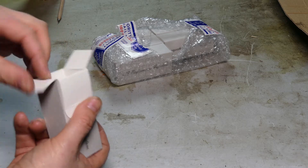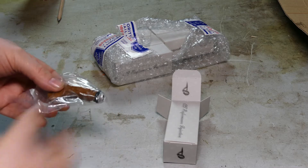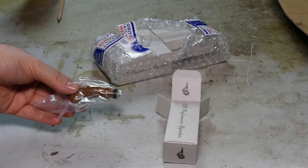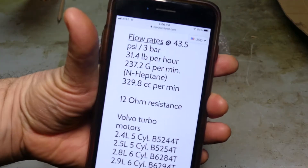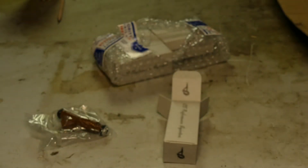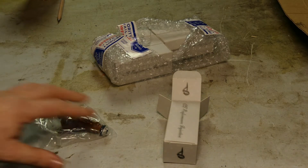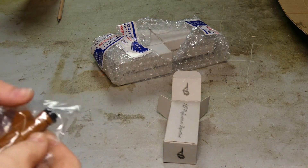You could also just go to the boneyard and get some. These are, if I recall correctly, 350cc injectors or 358. These are the specs on the injectors. I'm kind of looking to emulate T6 performance with this anyway, so we'll go with the T6 injectors at 329cc.